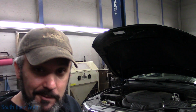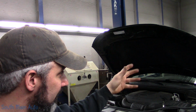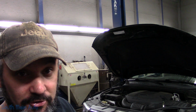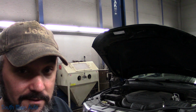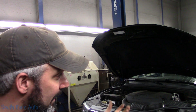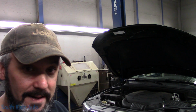Well, hopefully not yet. However, there are a lot of those plastic clips along that rear line. I had the customer come out, and we took a look at it together, and he agreed to give it a shot. I did take the sniffer and go down the rest of the lines and didn't find any other leaks. This is set up foolishly like the Caravans, where the rear evaporator sits up right behind that back tire.